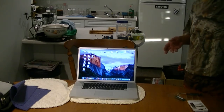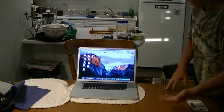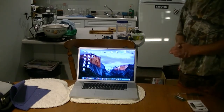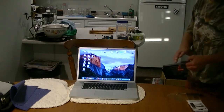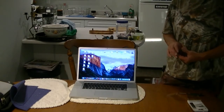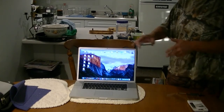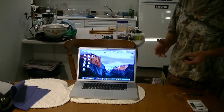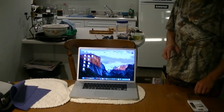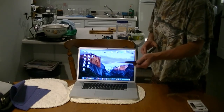This is definitely going to be a huge improvement. So there you go — that's how you upgrade your MacBook Pro to 8GB of RAM safely. This will not void your warranty as long as you don't do anything stupid and cook it. Ground yourself out like I showed you, watch those screws because there are three that are different lengths, and make sure you've got a proper-fitting screwdriver — it's very important that it fits absolutely perfectly, otherwise you'll screw up the heads on those tiny screws.